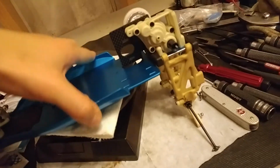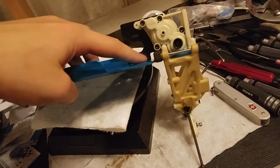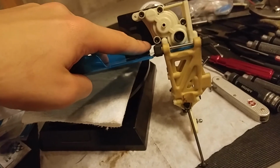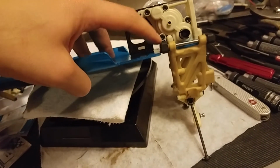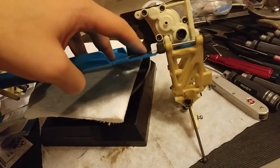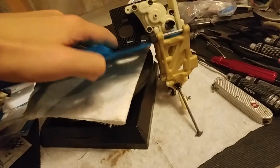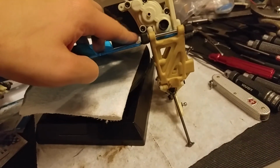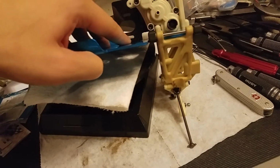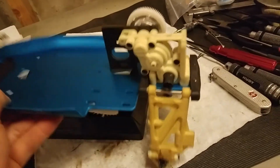So I mentioned, I think in the last video, when I got the motor mount, it's a flat piece down here, but I actually had to cut it out a little bit so that it would wrap around this front rear inner hinge pin mount. Otherwise, you just can't mount it. It won't go through. So, just mark it out, take a Dremel, cut it out. Actually cut out a little bit more material than I needed to, but that's okay. I'm not too worried about that.